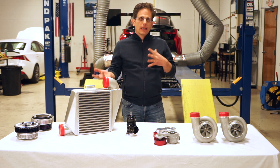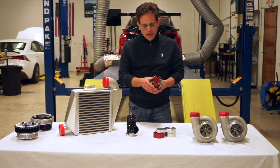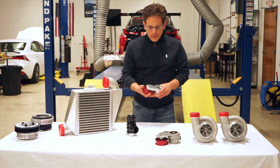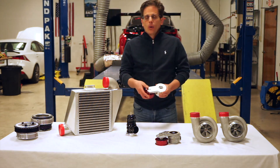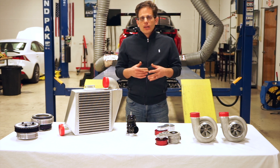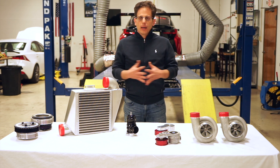The last major difference between the street kits and our higher-end kits is the tensioner. The tensioner in the street kits is still a good tensioner — we use our own billet pulley that has double bearings inside. But on our higher-end kits we use a billet tensioner that is able to tension the belt with much greater tension than our standard tensioner. That's important once you start upgrading to higher stages and higher boost levels, because without enough tension you will get belt slip. You can purchase the street kit now and upgrade all these components in the future.